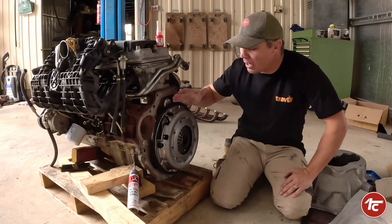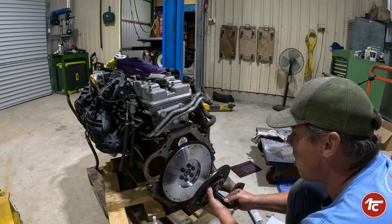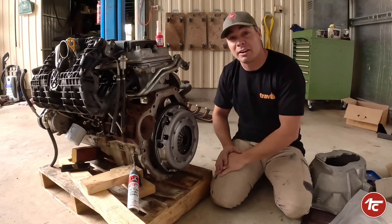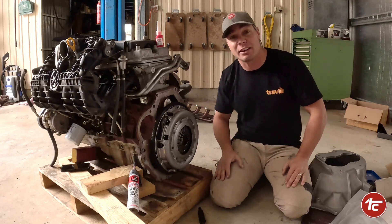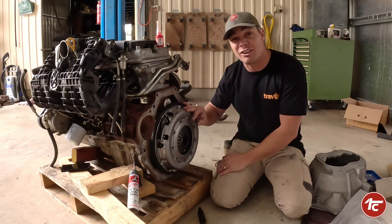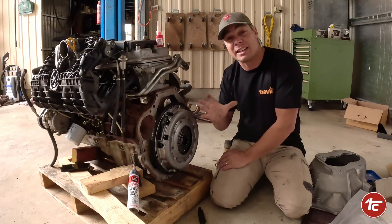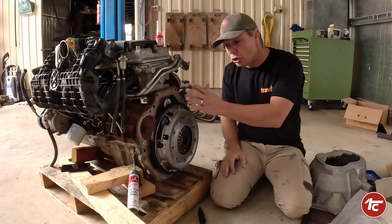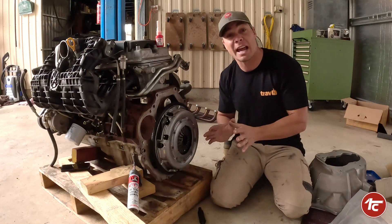Unfortunately my camera went flat as I was mounting up the flywheel and clutch assembly and I didn't even realise it. It's a very basic bolt-up — just make sure you have your clutch aligning tool and when you put it all together refer back to when we put the H55 gearbox in. Moving forward, we're going to be using the H55 five-speed gearbox that's out of the 60 and 70 series Land Cruisers. That's going to pair up really nicely with this motor. You can still use your four-speed box straight out of the 40 series with the same bell housing from Delos.